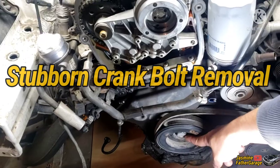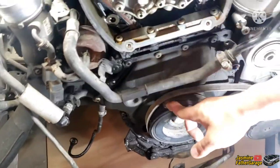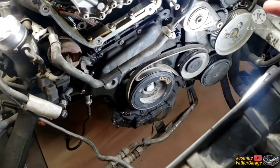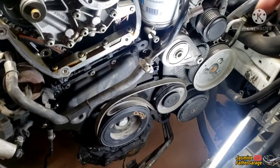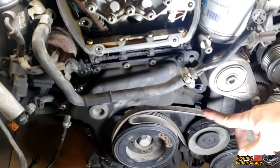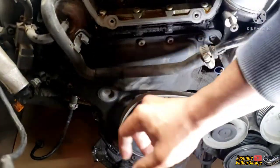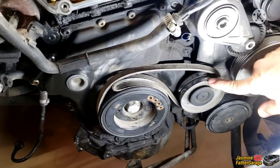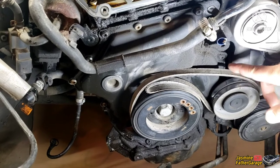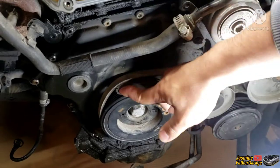I've got a little belt trick right here. To loosen the bolt it's counterclockwise — going left. So we set up this belt the right way so that this pulley is not gonna spin to the left; it'll stay steady. This is the setup on this idler pulley — just a random belt from around the garage, grab it and put it here.